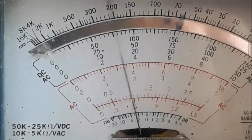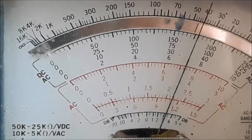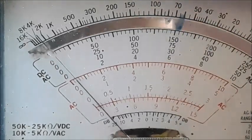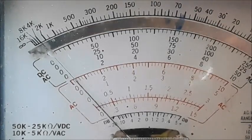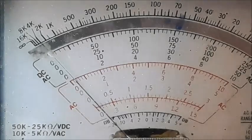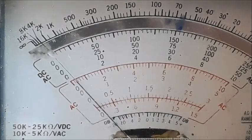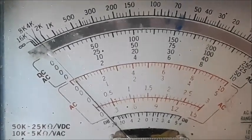It still goes right through the range. Now I've got it better — this is what we got on R1. It gives us a full 4K. Is that right? So my question is, guys — this is what I get out of the coil. Does that sound correct? I've got a feeling the primary and secondary coils must give different outputs. Let's go from the positive to the ground, which is the mounting plate. I get nothing on positive and nothing on negative — so that is totally sealed off.